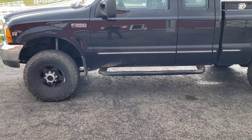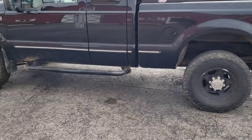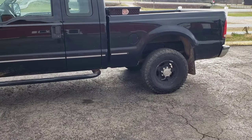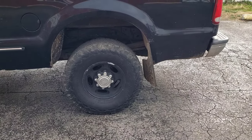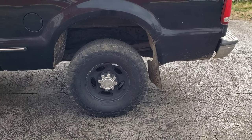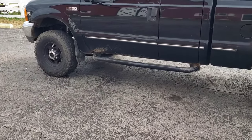I have the truck back together, adjusted the parking shoes, and have noticed a very big improvement on my parking brake holding power. I might go back and roughen it up just a little bit more, but this is a very tiny slope — nothing to brag about — but my truck wouldn't even hold this before. It's in neutral, parking brake set, and I've definitely noticed an improvement. If you think this might work for you, by all means — it worked for me. I'm going to do the pad break-in procedure as the manual says: go to a certain speed, apply the parking brake until the truck comes to a stop, and do that one time only to seat the pads. I hope this helps someone.